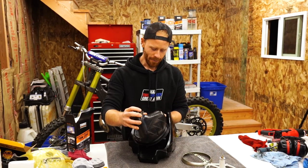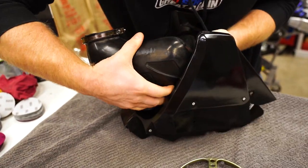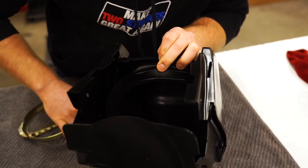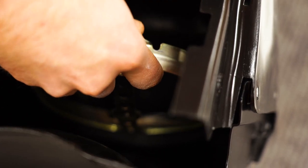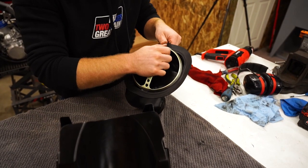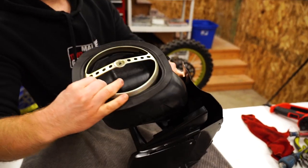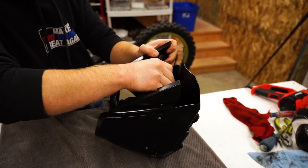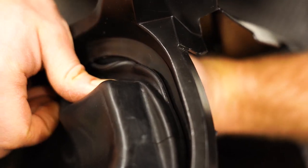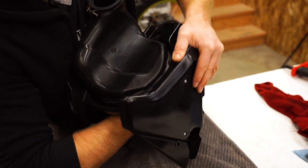I really like the design on Suzukis — the boot just slips right into the airbox. It doesn't need all sorts of crazy sealant and brackets like Hondas typically need. I think I'm going to have to kind of push the boot in to get this ring in here. I'll start it on the bottom, then try getting the ring in before putting the boot in to see if that's any easier. What if we go from the inside? This looks like it will be easier.